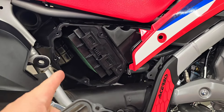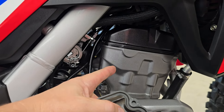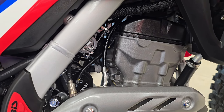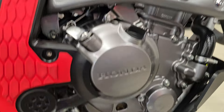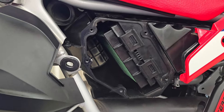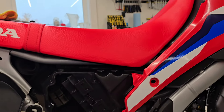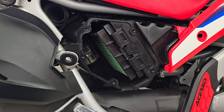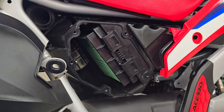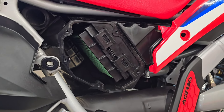This is the air that's going into your motor — it's going through your carburetor, into your top end, into your cylinder. And if it's dirty with dust and it's penetrated, you are sucking that junk into your engine. You can see I've got clean oil there, but that's just half the story — the other half is you want a clean air filter and clean fuel. Preferably non-ethanol, unless you're riding a lot and can get away with ethanol fuel.